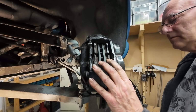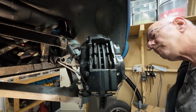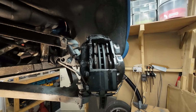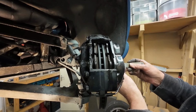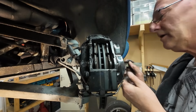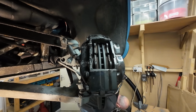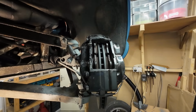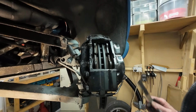I could try a wheel on, because that could be another issue, might be my wheel catching. I'm getting a better measurement now. From the outside edge of that to the hub face is 40 millimeters, and that looks to be 50, so I think they'll fit on. I can't successfully do this, as under all these nuts it's going to flop all over. I think I need to address one thing at a time.